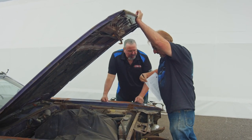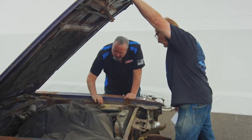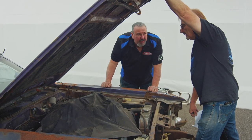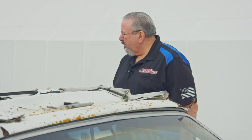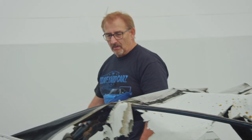Look, it has the later fenders too. That's your salt, that's your gravy for buying a car and disassembling. You got some pieces you need — you got the three-speed wiper linkage, there's some value in that. Where we could have potential beyond the average guy is that sometimes we have a cowl panel that's rotten, but for whatever reason maybe this little piece of the cowl panel is okay. That's one of the things I can have out of a parts car. They don't make convertible quarters, so you'd marry a new quarter with this piece on that hip line, or section this part in right here.